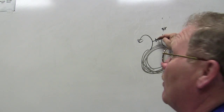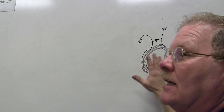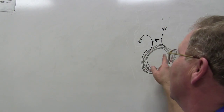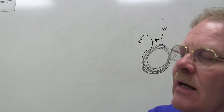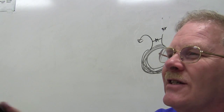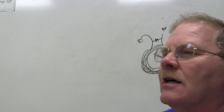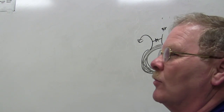See, the current can't go backwards through it. It can only go around. Whenever that thing de-energizes and that magnetic field sweeps across those copper windings and creates all that voltage, it chases its tail and goes away. Even these little relays, you might notice that typically they'll show on the schematic of the relay a little clamping resistor for the same reason, because they don't want that thing bouncing 50 volts or more back to whatever was energizing it.